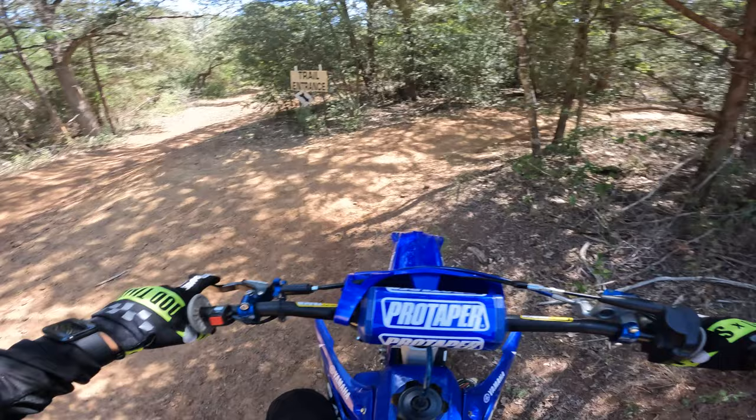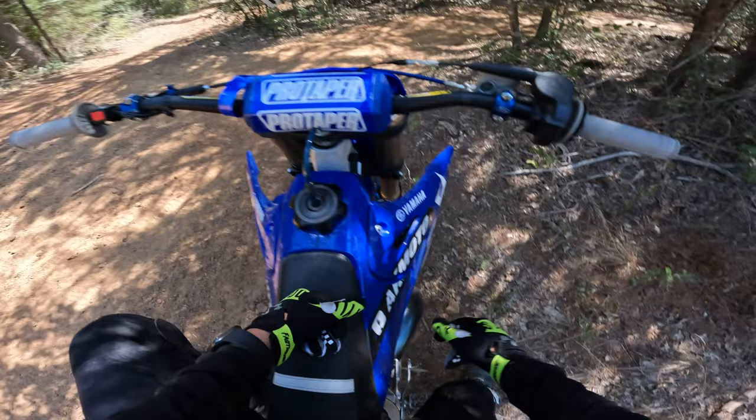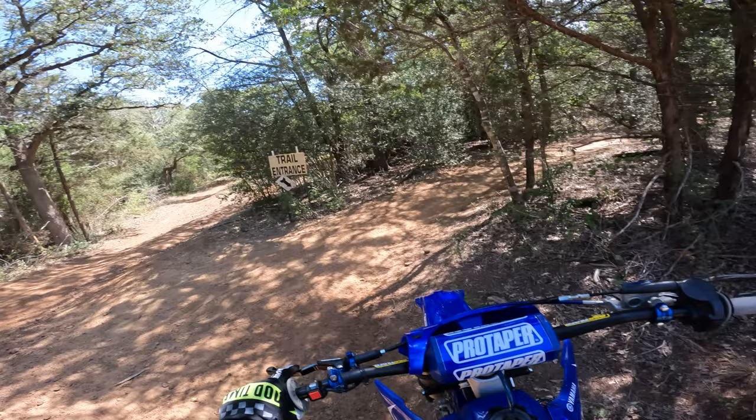Alright guys, so I got a one step leaner pilot, I went from a 40 to a 37.5. Pretty small step, but we're gonna test it out here. And I actually went from a 415 to a 420 main, so I richened up the main, leaned out the pilot a little bit. Very, very small steps in both directions for the pilot and the main, so very small changes, but now we're gonna take it out on the trail, test out this pilot jet and a little bit of the main jet, so let's go rip.